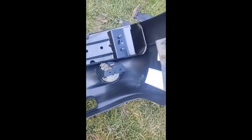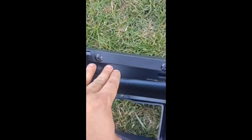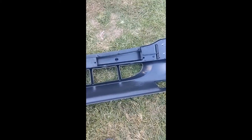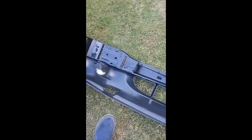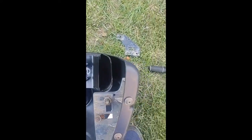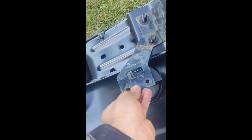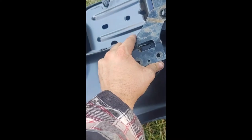This is the brand new bumper. It had original tabs and I put all brand new tabs along the bottom. I couldn't find tabs for the other spots, but eventually there'll be four square fog lights in there. I cleaned the fog lights up real well and they look very good. I had to take these brackets off my original bumper since the new bumper didn't have them — these slide on, two bolts go in, and it is very important that you have these on there correctly.